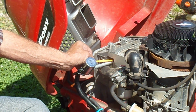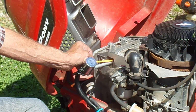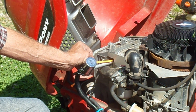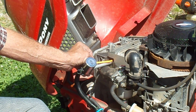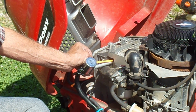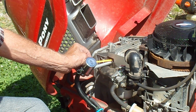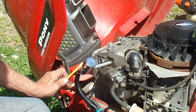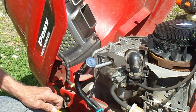And there were 2 different sealants that I used. The first one I did, I used a Seal-All. It's in a yellow tube. I think Advance Auto Parts has it. I've used it several times and it works very well. I let it sit 24 hours before I did anything with it. The other one, JB Weld has a muffler sealing compound, and that's what I used on this one here. So you can take your time and do it and see what happens.